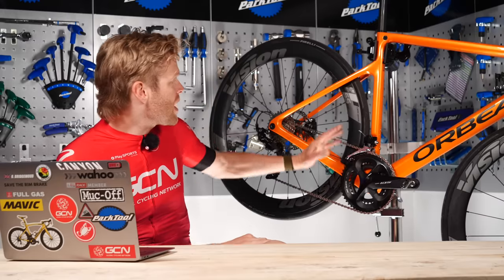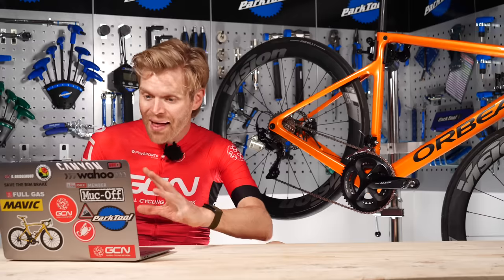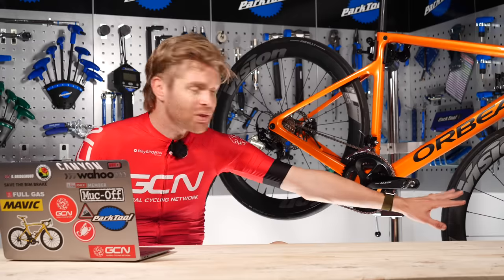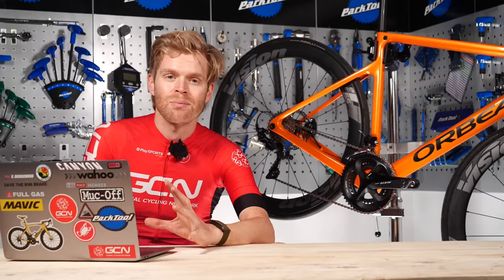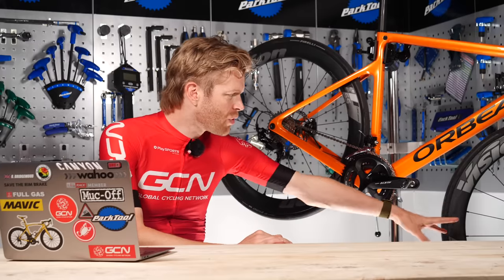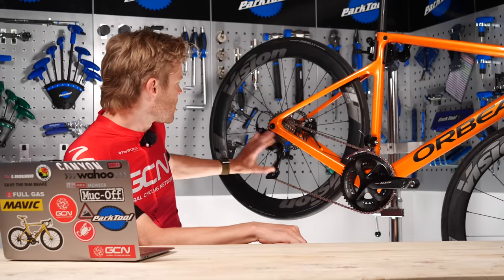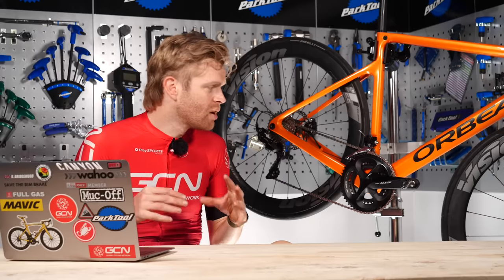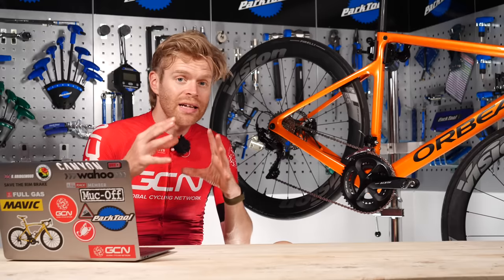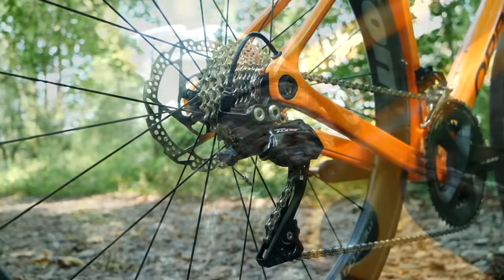And if you're wondering what the weight is of this R7000-105, well, with disc brakes, because this one does have disc brakes, we're looking at around 2,280 grams. But I say around because there's quite a few variables there. So for example, if you were to change the size of the rotors, the size of the chain rings, or the size of your cassette, it can kind of alter it ever so slightly. Also, that weight I'm quoting you there doesn't include the hydraulic lines as well, which is kind of important.